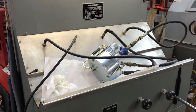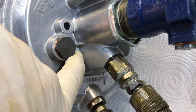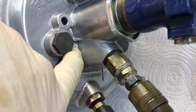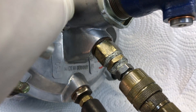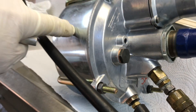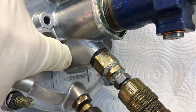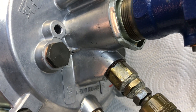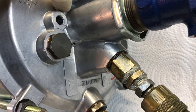Hello Jim G, this is your brake booster that I fixed on my test machine. As you know, the issue was seepage out of this bleed hole right here, which is your first indicator that there's an issue inside the brake booster. It's designed to leak here before the brake fluid gets into the vacuum chamber back here, so if this starts leaking you know you've got a problem inside the booster. Brand new from the factory, these boosters leaked because they were not manufactured correctly internally.